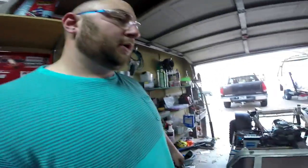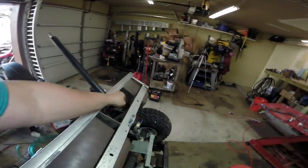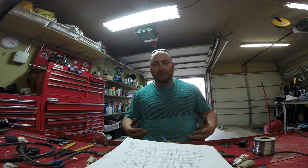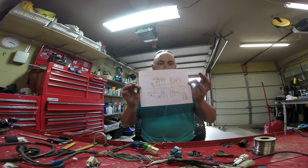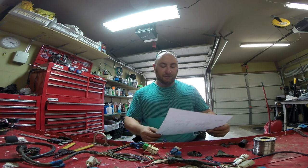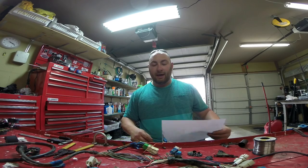Horn sounds good — we've got a little beep beep. I got the starter button in but it's not connected to anything yet, so we've got to get back to finishing our wiring harness. A lot of people find rewiring a harness daunting, but the thing you want to do is start with this wiring diagram — with this single picture, if you understand what you're looking at, you can literally rebuild the entire harness from scratch. What I like to do is go through and label stuff.